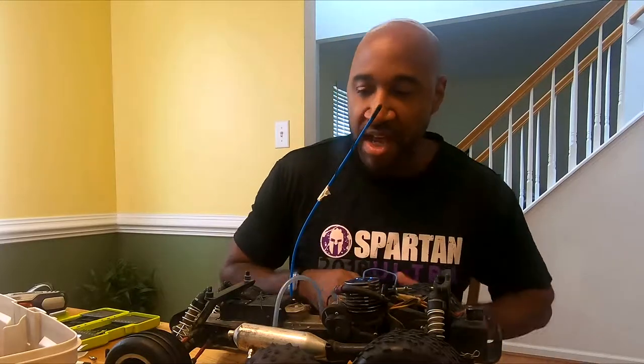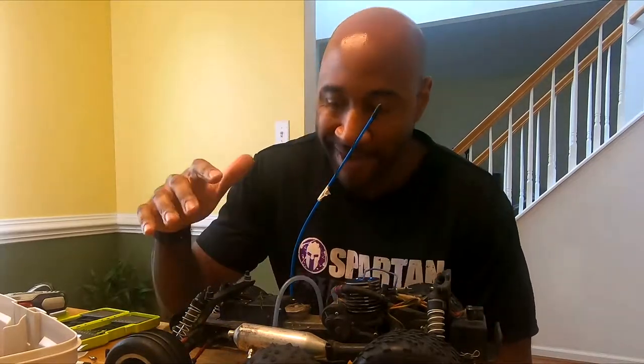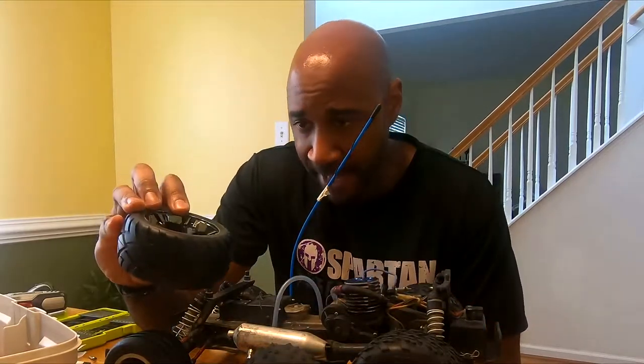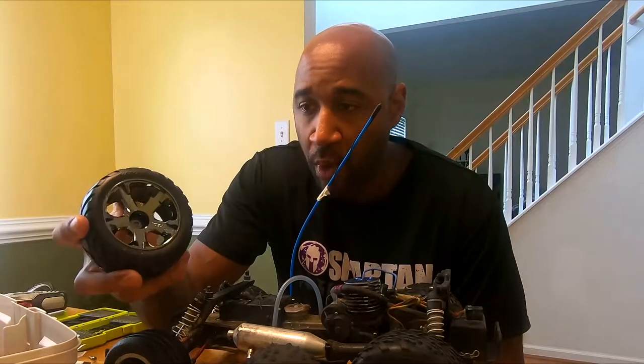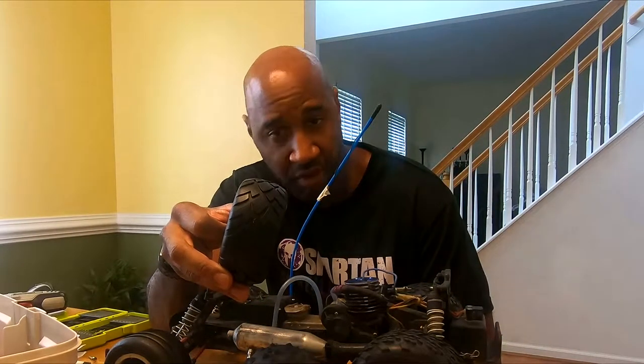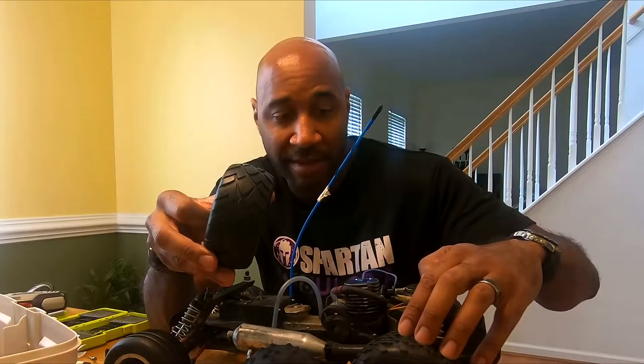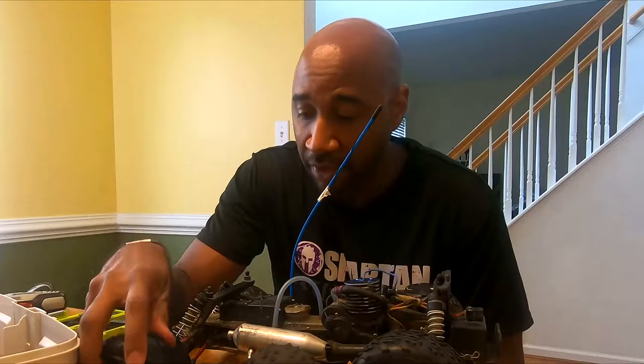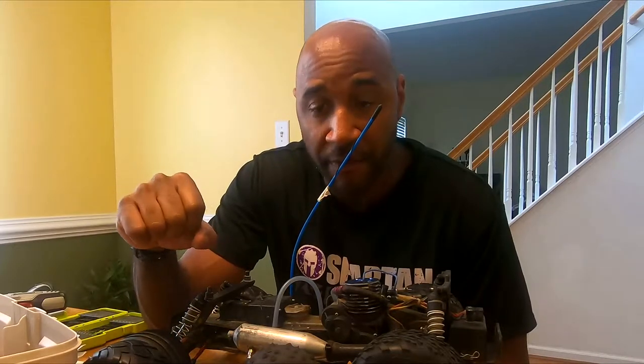The reason being, this is a rear-wheel drive truck, so it doesn't actually need any of that kind of tread for the front. And these Anacondas are a little bit smaller, a little bit more lightweight. I also like the profile of them — they're round, so as it turns and angles you're not getting that weird contact patch. And I just kind of like the look of the slightly skinnier ones up front versus the back.